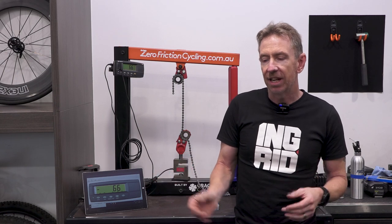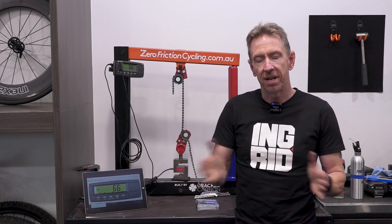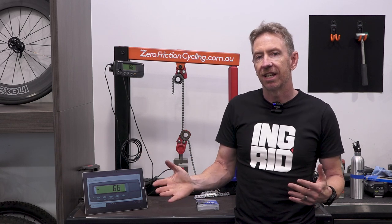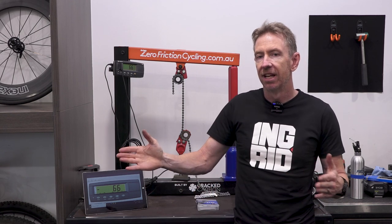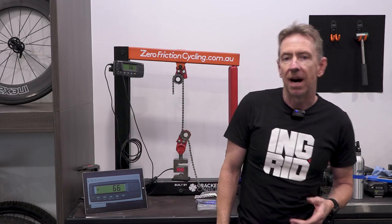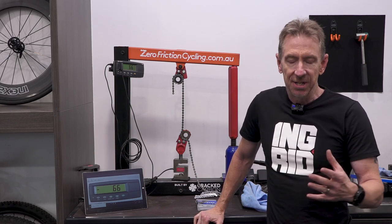With a derailleur chain, there is a fair bit of pressure on that pin riveting. So how well a particular chain model or manufacturer is doing the riveting on the pin is going to determine a fair bit with regards to how many failures there are for that chain brand or model on chain line angles. That can come into play in those scenarios, which is a lot of the time when you're riding on a chain line angle, and that's not going to show up in straight line testing. But we've been working our way down to a bit better knowledge on chain tensile strength overall, which I'll share with you today.